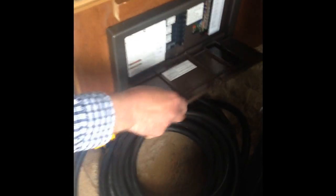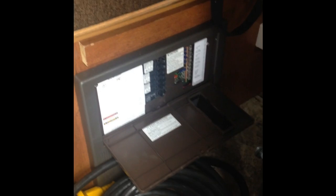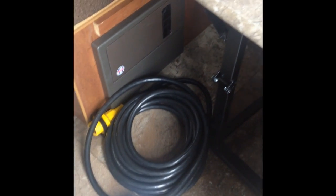Under here is your fuse panel — circuit breakers for the 110-volt system just like at home, and automotive-type fuses for the 12-volt. This trailer doesn't have a master battery cutoff switch, though some do. If you're going to keep it in storage for an extended period, disconnect the battery because you've got sensors and LEDs that will slowly drain it. You can also install an aftermarket cutoff switch. While you're towing the trailer, the battery charges from your tow vehicle, and it also charges when you're plugged into electric.